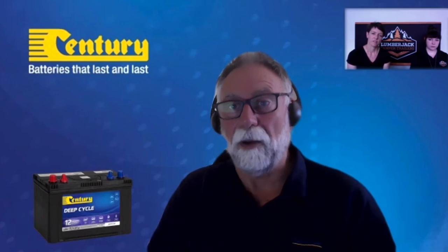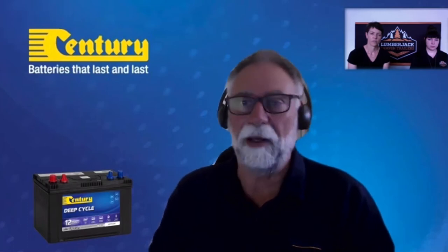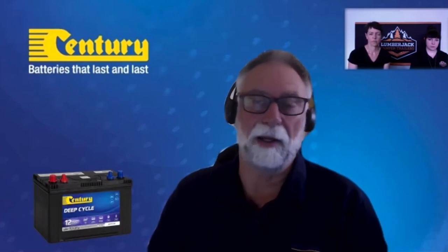My camper shows a charge reading while on charge, but when I take the charger off it drops down — why? That's quite normal. You get what's called a surface charge in the battery. The charger is designed to charge higher than the 12.6 volts the battery will sit at, to recombine the electrolyte inside. Once fully charged and the charger is disconnected, the reading will settle — generally after a couple of hours — back down to the resting open circuit voltage. Nothing to be alarmed about.